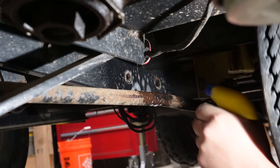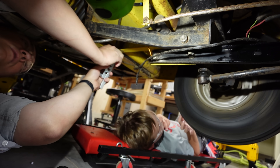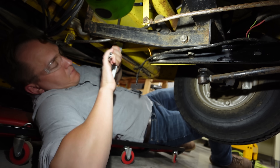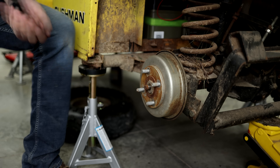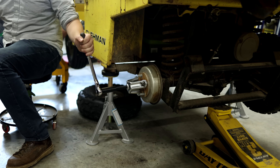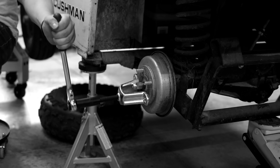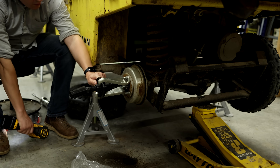Malcolm and I painted the frame. We prepared the old brake line for the splice using an old-fashioned flaring tool instead of the fancier one we used earlier, because that fancy one needs to be in a vice to work. The old-fashioned one actually worked okay, but no doubt the fancy one is way easier to use. Then we reinstalled the master cylinder and hooked up that splice. Next, we needed to get the drums off the rear wheels to reach the brake bleeder valve easier. These drums were really on there, and regular-sized pullers don't fit — they're too big. I ended up ordering a separate octopus-looking puller instead, and that successfully pulled the hubs off. It's always super scary doing this.